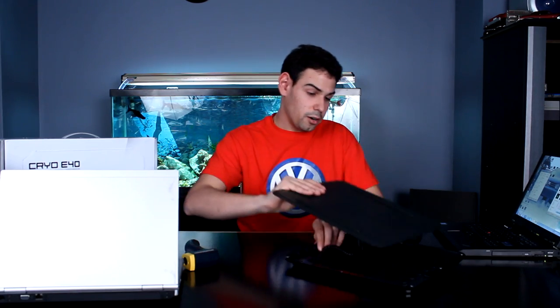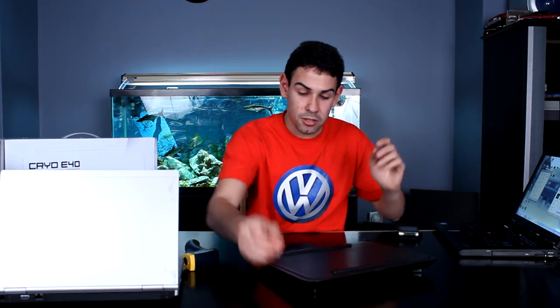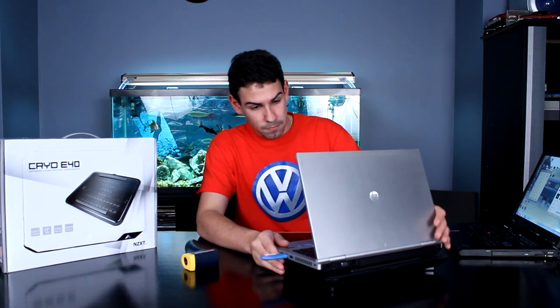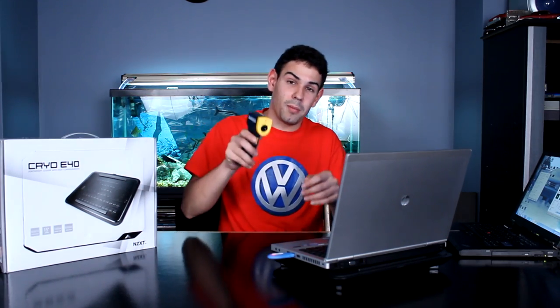So let's put it there, line this up — it snaps in, looks nice and easy. It's light and thin. One of the best things about a laptop cooler — one of the reasons I'd buy one — is that it raises the laptop up and gives it a bit of an angle, makes it easier when you're typing, or if you're sitting on a bed. So I just plugged it in — we're running at about 84 to 85 degrees and 77 on the other core. I'll let this run for about 10 minutes and report back on temperatures. We're also going to use a heat gun to measure actual temperatures coming out the back of the laptop and on the surface of the bottom and side.